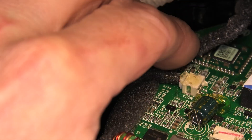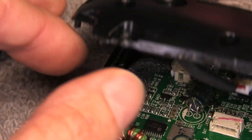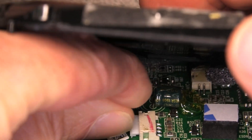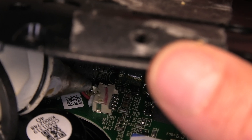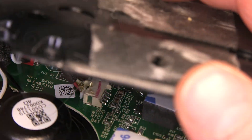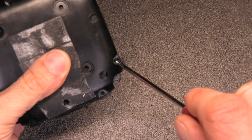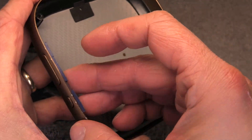Once you have your new battery installed, make sure you have the antenna connector reattached, because otherwise you may have really bad reception if you forget to do that later on. Then also plug in the battery again and add some more hot glue to make sure it really does not come loose later on. Now we just continue with the reassembly — attach the 8 screws, the smaller screws on the sides, putting them in and then tightening and fastening them.